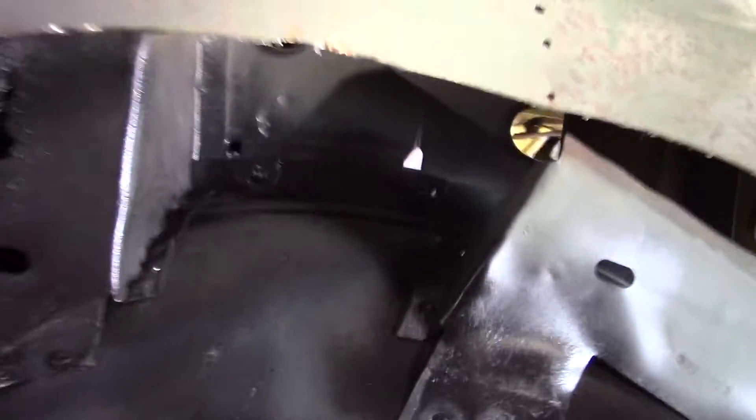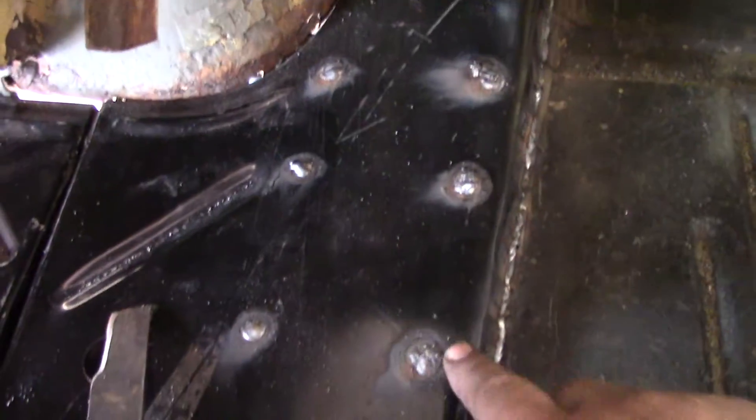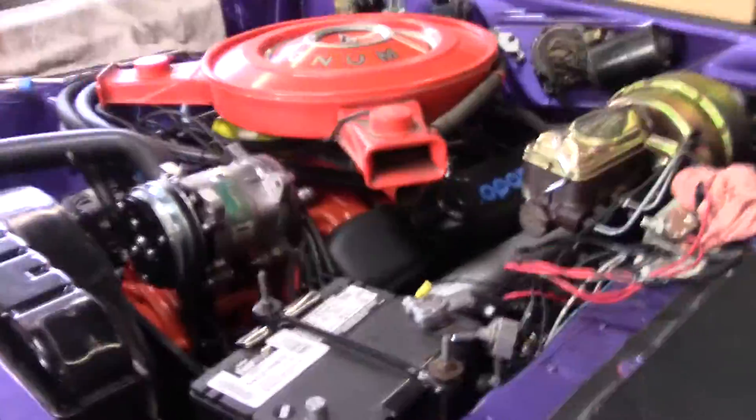We're slowly working on putting a quarter panel on this thing. Pretty rough — we just cut that off for now. Somebody had put one on here, they jigged it up and messed it up. We're going to put a full quarter on. I welded this top in there — wasn't too easy but I did it. We'll grind these welds down; you'll never know it was there. These are rare because there weren't many produced, plus a lot of them rotted away.